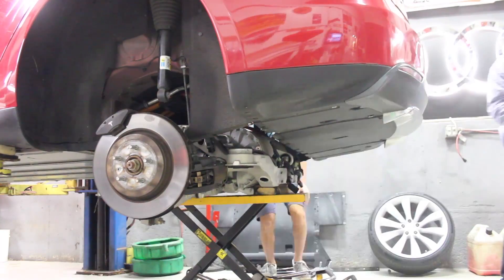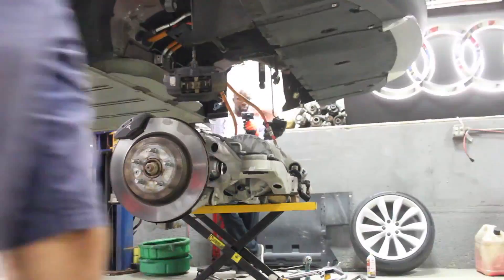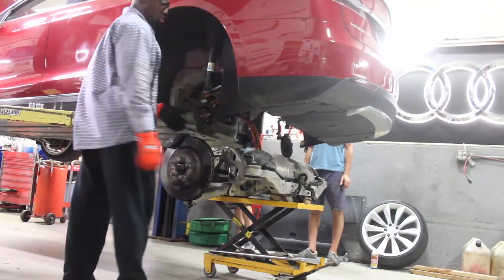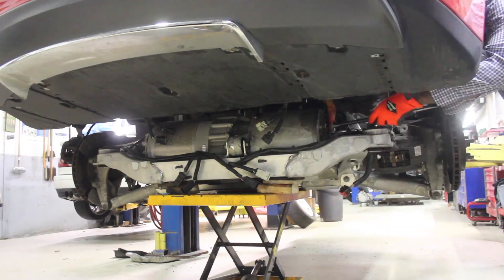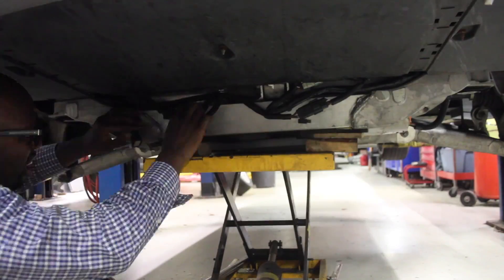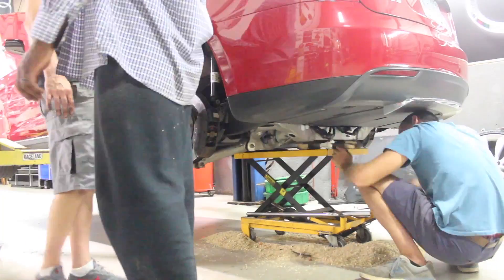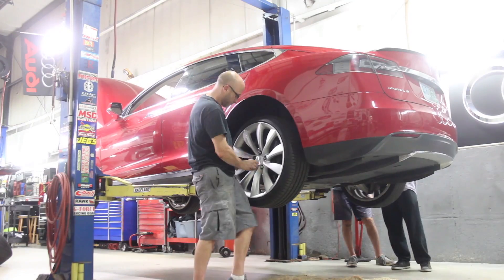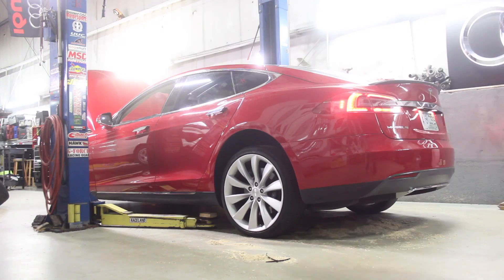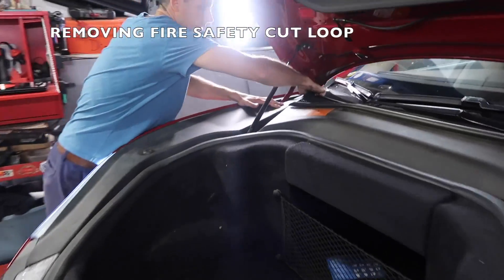But today you're going to see a very rare sight. We're going to take a look at the inside of a Tesla drive unit that has never been replaced by Tesla. Remember, Steve's car is an older prior salvage vehicle that Tesla will not service in any way, so it's been using the same original drive unit since 2013. Most of the cars I've come across are not on the original drive motor either. Steve went ahead and found the exact bearings necessary to replace the ones inside the motor, and we'll see if that solves his grinding issue.